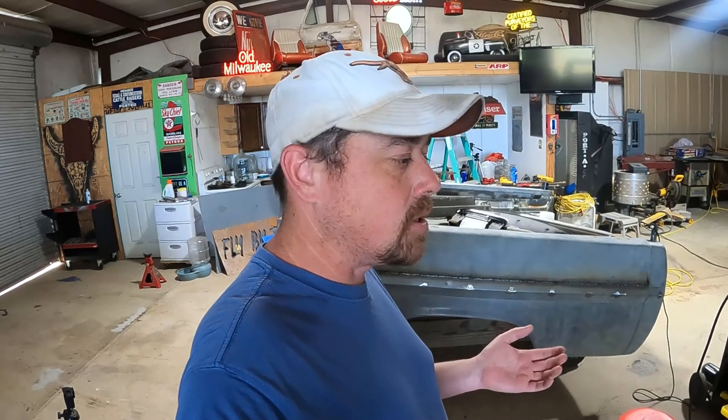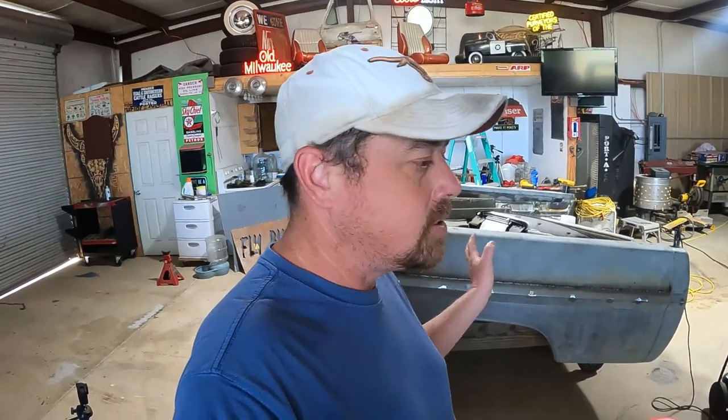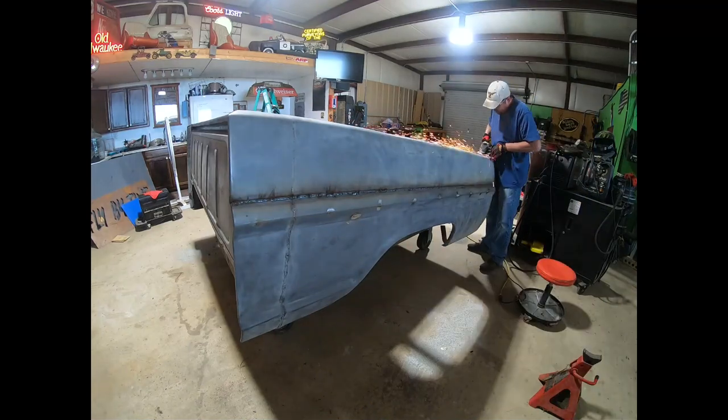But if you're going to do that like I am, then you want to go down to a local paint shop where you can buy paint. Find out what brands of Bondo they have. Not the Bondo brand, but similar stuff. There is other stuff out there. I don't know the names of them right off the top of my head, but the cure time is a lot longer, and so you've got a lot more time to work with it and get it onto the car. Unfortunately, I bought the cheapest stuff I could find, and so I am going to be working pretty fast with the Bondo in order to lay it down.